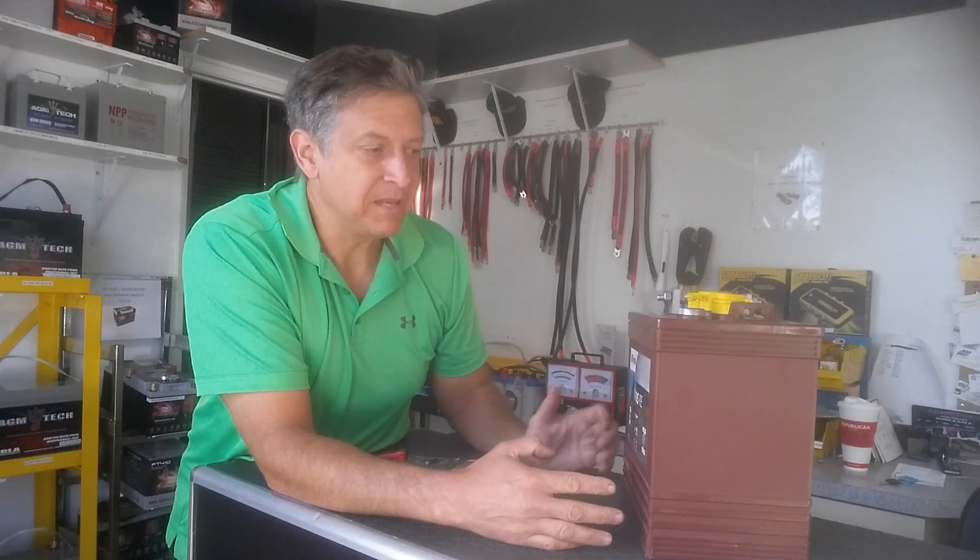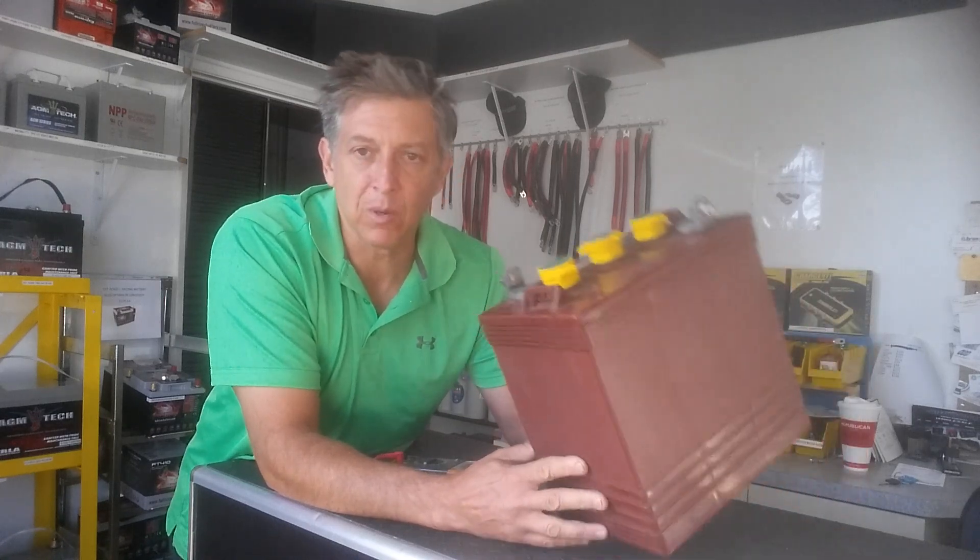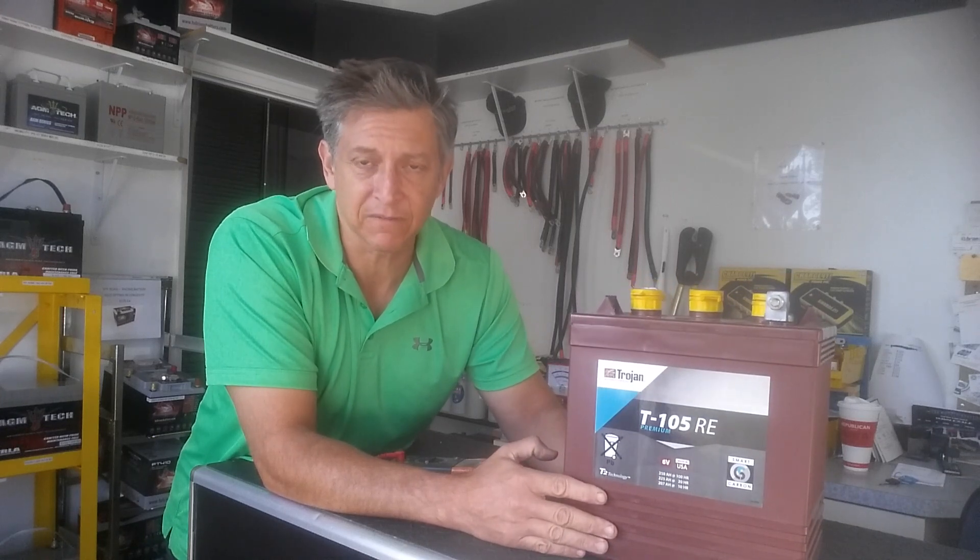I hope that helps you. If you haven't been keeping your batteries on charge and you have your toy hauler, fifth wheel, or RV just parked and you have not been on shore power, there's a good chance your batteries are going to be flat and fully discharged. These batteries lose about 1% per day by themselves. So if it's been a while since they've been charged, they're going to be really resistant to charge. People ask me all the time what they should charge with — well, 2 amps is not going to do it, and a trickle charger won't work either. These batteries gain resistance and you have to overcome it, so you're probably going to need at least 10 amps if not higher.